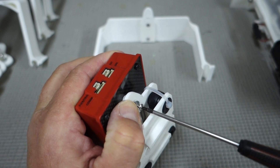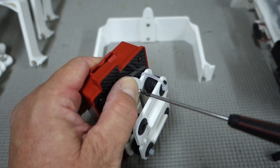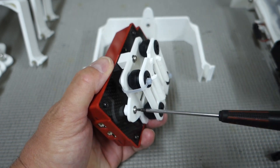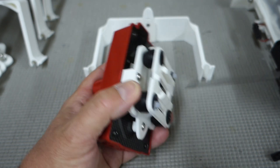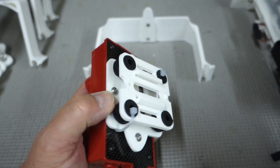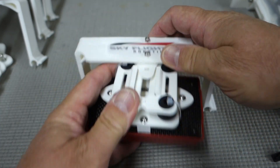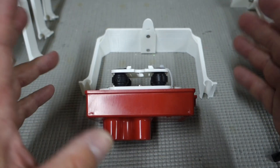Leave about a sixteenth of an inch on both the forward and back screws. For the side screws, push down a little bit — it invokes slight stress into the plate, which is what we want so the screws don't fall out when you take the mount off. Run them in and snug them up. The moment you feel them start to bottom out, just a light snug — don't reef on them because those are rivet nuts you're threading into and you'll break the bond. You'll notice the gaps close up. This is now mounted solid, and you can see how it snaps on and off very easily. The next video will be the mechanical mounting onto the helicopter.